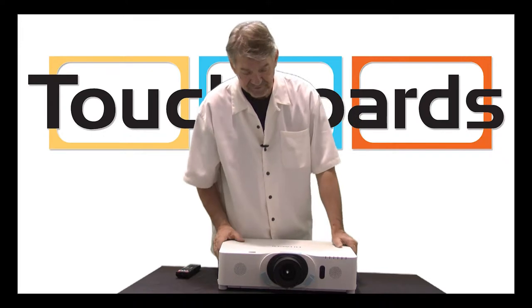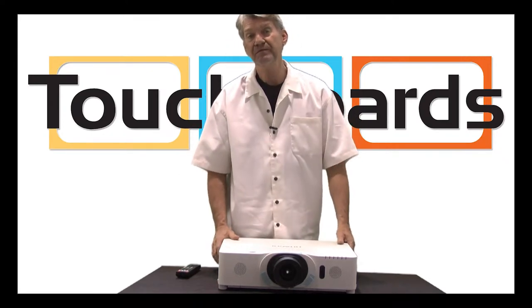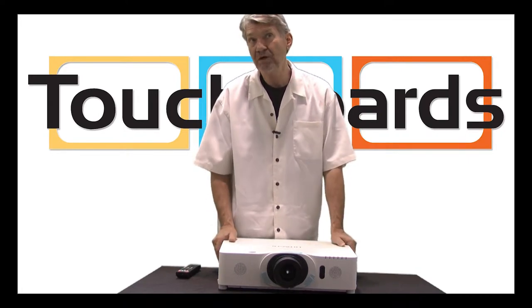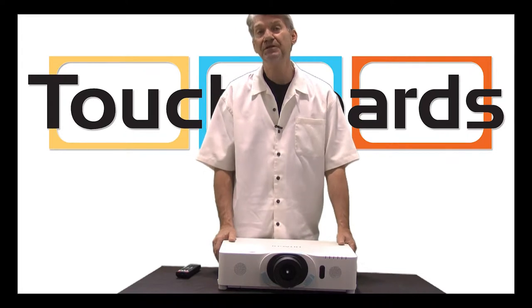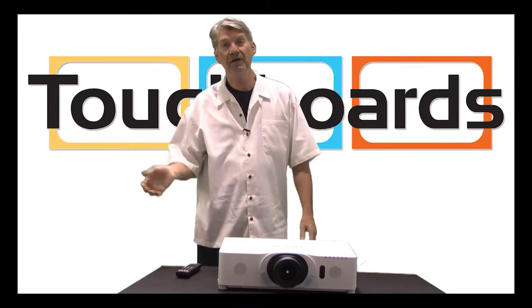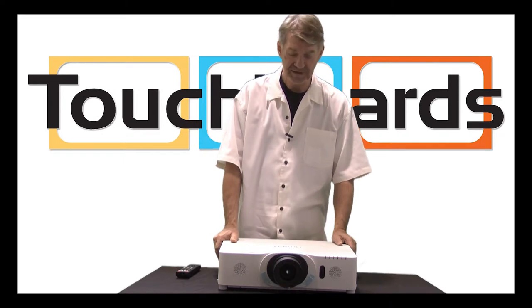Front throwing. There are five different lenses available for the projector, from the short throws right out to a 21-times throw ratio lens, meaning that the same 10-foot image can be captured anywhere from about 12 feet to about 210 feet with one of the appropriate lenses installed.